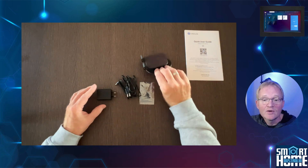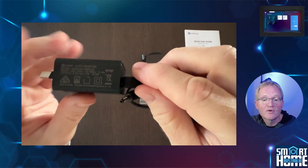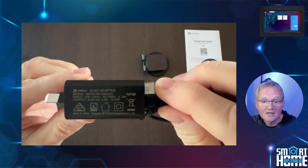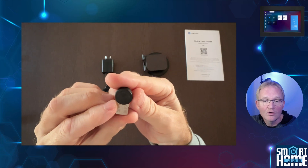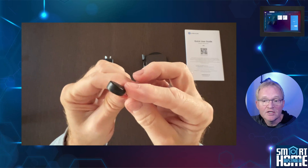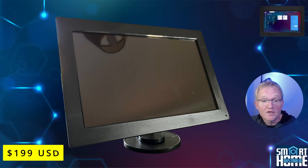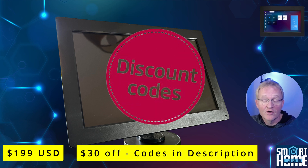In the accessories box, you get a power adapter and a 1.5 metre USB 2 barrel jack power cable. The power output is rated at 5 volts at 2 amps for a total power of 10 watts, so the ISG sips power — remember, this is powering the screen as well as the ISG, which in turn runs your Home Assistant instance. The unit is provided with a Zigbee USB dongle, meaning you can remove it and upgrade that component if required. You get a magnetic disc stand that allows for pitch and rotation adjustment, and you get all this for $199 US — although until the end of June, use the discount codes in the description for a further $30 off.